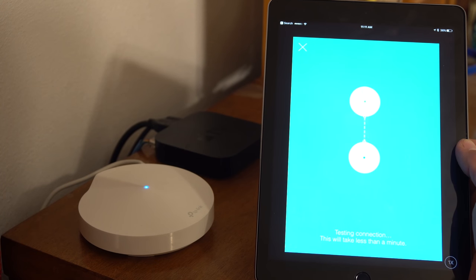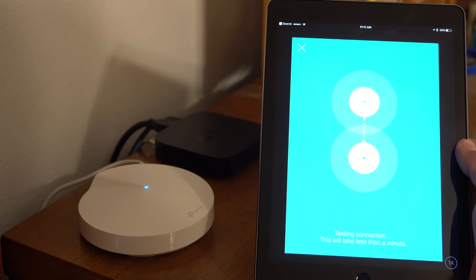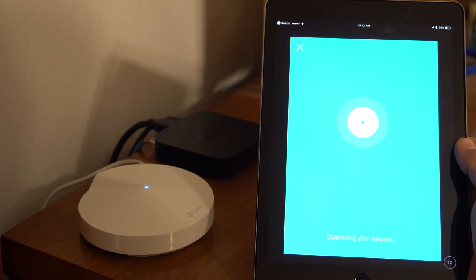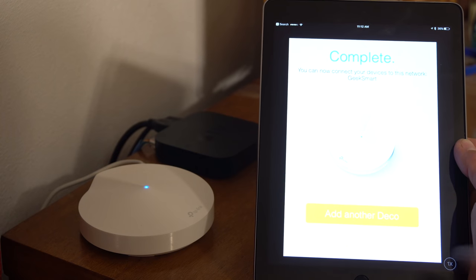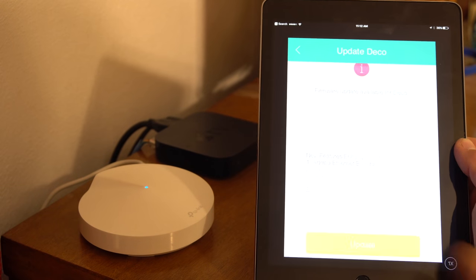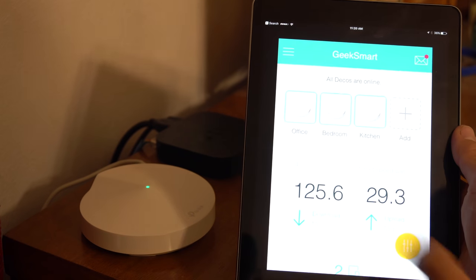I'm connected to the Wi-Fi downstairs while connecting Bluetooth to the third unit in the bedroom. Found it — the light went solid — connected to Deco, checking the connection back to the main unit. We are green and good to go — it's turned green. Optimizing the network, naming it and completing setup. I hit done and now all three units appear in a row in the app. There's a firmware update available, so I'll go ahead and update — that took about five minutes and everything went back to green.